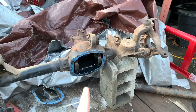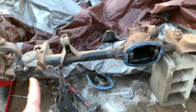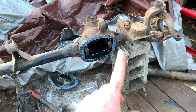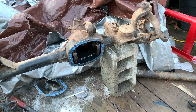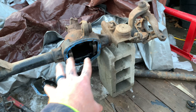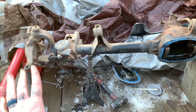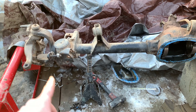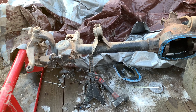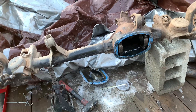The one thing we're not upgrading right now is the axle shafts and the knuckles. The reason we're not doing anything with the axle shafts is because whether it's a low pinion or a high pinion Dana 30, the ring gears are soft — so I want the axle shaft to bust before anything in here busts. We're going to go with WJ knuckles down the line; I have those coming but it'll take a while. We can change the knuckles out anytime. Basically we're focusing on the front end itself and getting it beefed up to handle 35s.